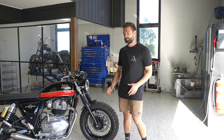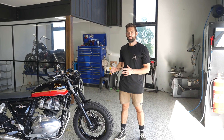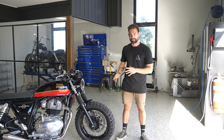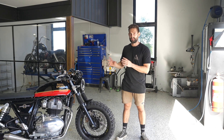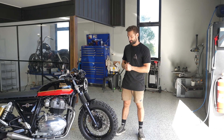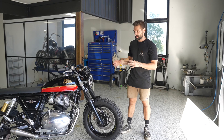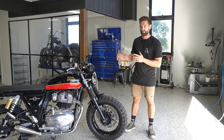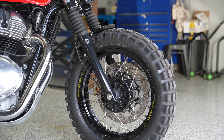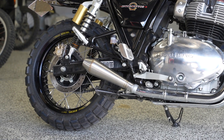The first major thing you're going to notice on this bike is the wheel set. These have been based off the standard Royal Enfield hubs. The bike as it comes with a 19-18 setup — real skinny tyres. Jefferson, our client, wanted something a little bit bolder. So we've stripped the standard wheels and relaced them to a 17 front and back. We're now running a 130-17 on the front and a 170-17 on the rear.